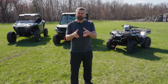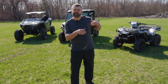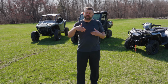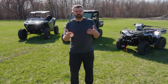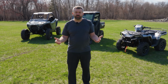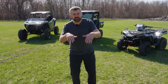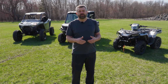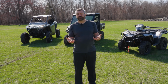Now, again, the way that this one works is it basically relies on the fact that the drive clutches are still going to be engaged so that the rear wheels are back driving into the engine, and then it couples the front end back through the prop shaft to the transmission so that you get all four wheels helping to slow the vehicle down. For those of you who have ever driven a vehicle with a manual transmission, when you let off the throttle and you leave it in gear, you feel it kind of brake the vehicle. You get that back brake effect without having to actually hit the brakes. The ADC system works in a similar fashion from the feel to the rider's perspective, but the mechanics of it are actually a little bit different.